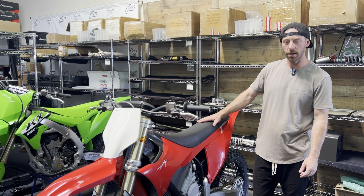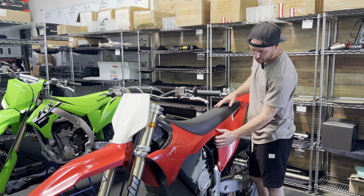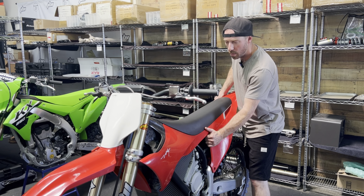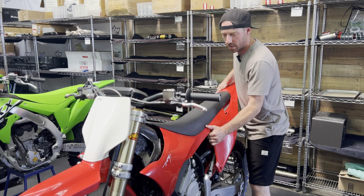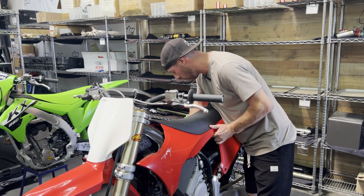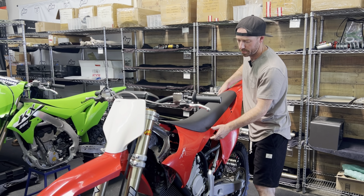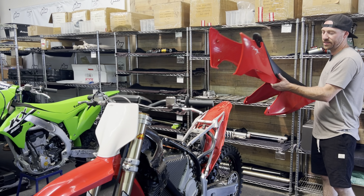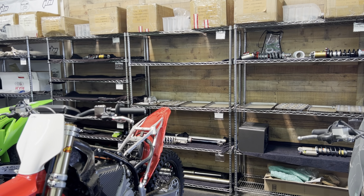Now for removing the body paneling from the bike, take your left hand and grab these two pieces of plastic, holding on to both, and use your right hand to grab onto the rear fender. Pull back and maybe wiggle a little bit and you'll see the whole assembly work its way off. Really beautiful design — everything fits in quite well. That's going to give us a lot of access and room to work on this. I'm going to set this aside out of the way.